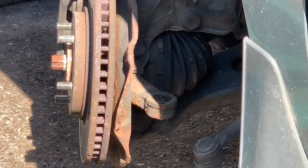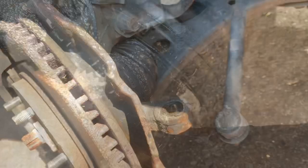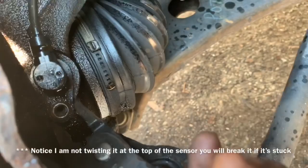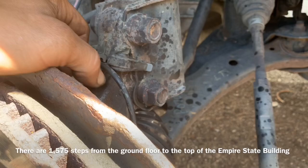Taking a little bit of penetrant, we're going to go down here and put penetrant around the wheel speed sensor. We're going to remove the wheel speed sensor bolt. Sometimes these are rusted in, so you're going to want to take a pair of pliers and try to twist it so it doesn't break off the tip. Taking the wheel speed sensor strap, pull it off — you can use a screwdriver or your hands — and set it off to the side.